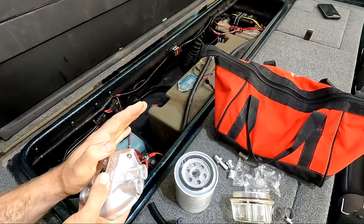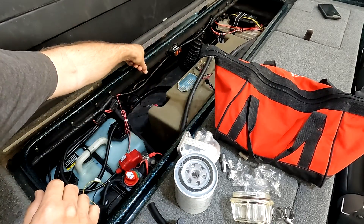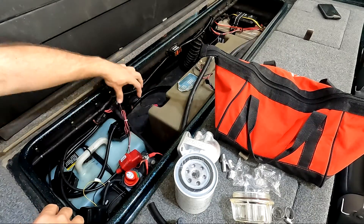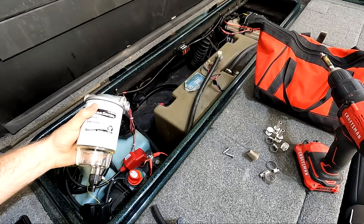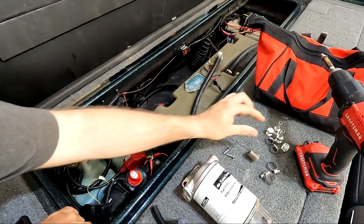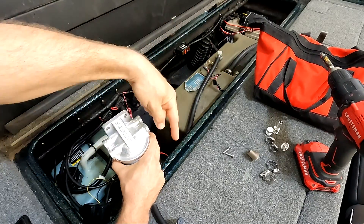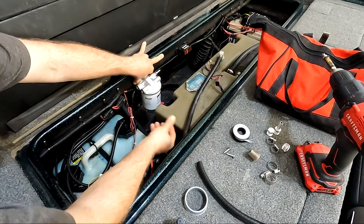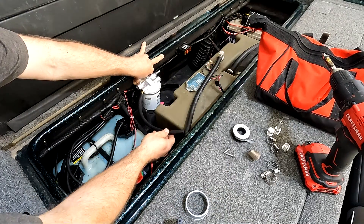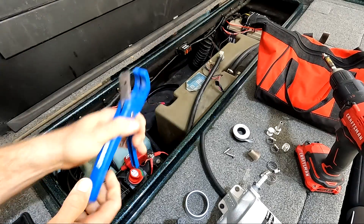The biggest question for today is where I'm going to cut this fuel line. I need to cut it at a length where I can move it over into the inlet port and then connect back. I don't want to cut it too short so it won't reach the inlet port, but I don't want to cut it too long either. I'm going to install one of these plugs — my plan is to have fuel coming in one way and out the other, keeping the fuel line running basically in the same direction. I'll cut it around about right here, then run this fuel line out and connect right back into it. I'll use one of these pipe cutters for a nice flat, straight, clean cut.